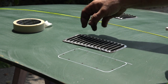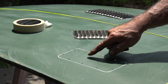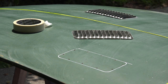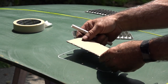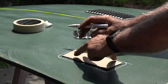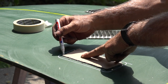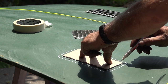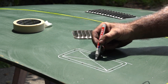We've drilled the holes and I think it's a pretty good match. You probably saw while I was drilling that the panel went down a bit — can you imagine how bad that would have been if you'd cut it out beforehand? That's why you need to drill the holes first. Now we're going to mark the part that we're going to cut out — the most important part — and you want to make sure you have sufficient edge around it. There we go, that's the part we're going to cut out.